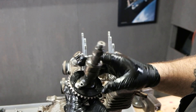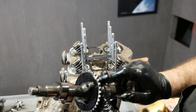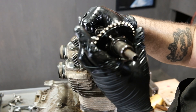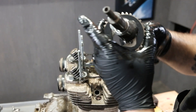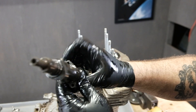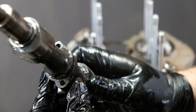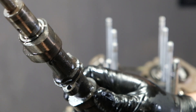On the back side here, I'm going to point out — see how that ear is all round? See how this one has a round shape and it has a flat on it? That should be the side for the bolt that has the shoulder on it. Let me show you guys. We'll look real closely inside the bolt holes. This bolt hole is threaded all the way, and that bolt hole — the first eighth of an inch — is not threaded. So that's how we know which bolt goes in.